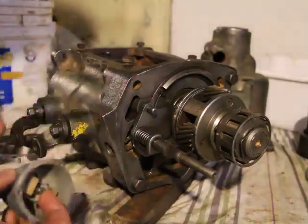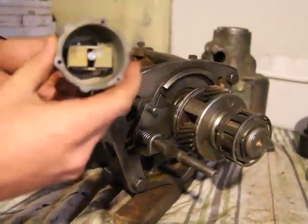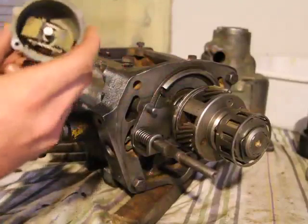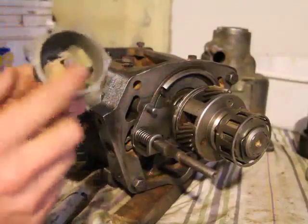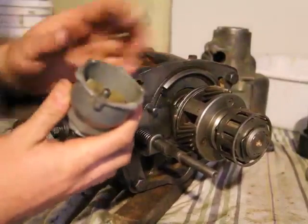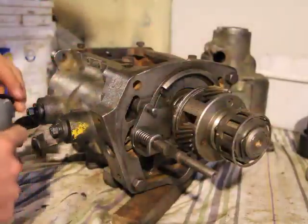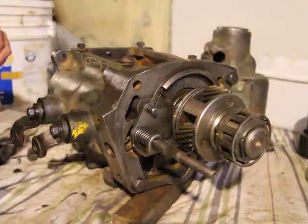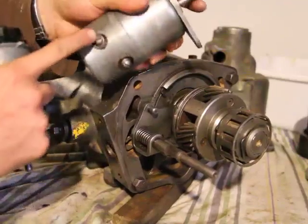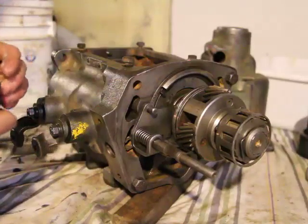Okay. And I believe there is a spring that holds them, or not. But anyways, as they're going really fast, you'll see that they spread apart outwardly like that, thereby pushing this cylinder, this rod here upwards, which pushes the contact points here, thereby completing the circuit. And it sends electricity. This is connected to the number 6 terminal here, which causes one of the windings to get energized.